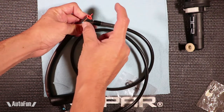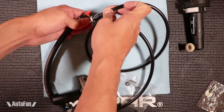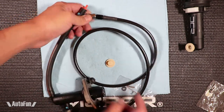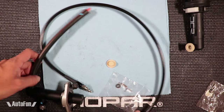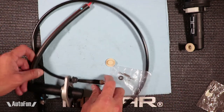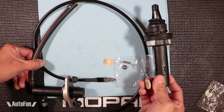As I'm pumping, the slave cylinder is going to start to suck up the fluid from the reservoir. This end is always submerged, and as I keep pumping, the bubbles or air are going to travel up and burp out of the reservoir. It's important to always keep that reservoir filled with liquid so this thing never sees air — it's going to be a matter of pumping until we get all the air out. This is just an overview; I'm going to demonstrate this on the bench.